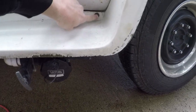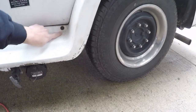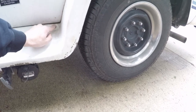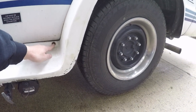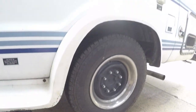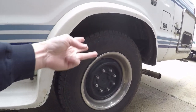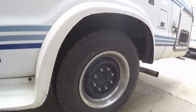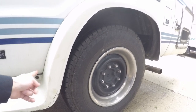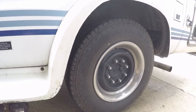This plug here is for air. The rear has air springs that I installed — one on each side. You just put the same fitting you use for inflating a tire right to this thing and inflate it to about 55 to 60 psi, which I found to be a good pressure to give the rear end some support. Because you've got a lot of weight in the back — your fuel tank, fresh water tank, black tank, generator — all that stuff is in the back. So before you take a trip you air those things up and you're good to go. It really made a difference to keeping the thing stable going down the road.